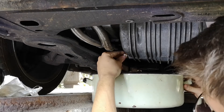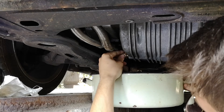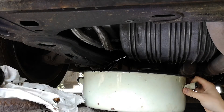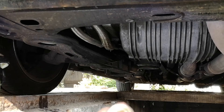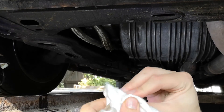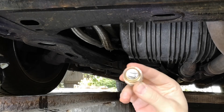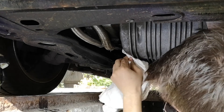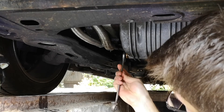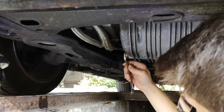Now comes the time to drain the oil. The tricky part, always, is to remove the drain plug without actually spilling oil everywhere. This is how the plug looks up close — as you can see, it has a magnet in it for metal particles. You don't want to see metal particles in there. Now would be the time to actually exchange the plug, or at least put a new seal in there. There's a link in the description so you can check prices. I needed the car immediately so I decided to return this one and prepare a new plug for the next oil change, which is going to be soon anyway.